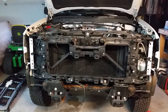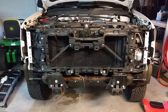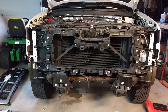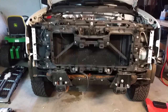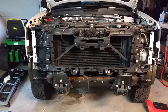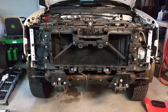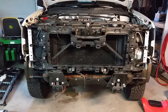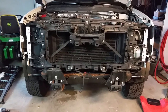The first thing to know is that the easiest way to get these fog lights dismounted so you can put the new Morimoto ones in is to simply take the front end of the truck apart. You really need to get the bumper off — and to do that you've got to take the headlights out, the grill, the plastic fairing on top of the bumper, and then the bumper itself. That makes the install of the fog lights a lot easier.